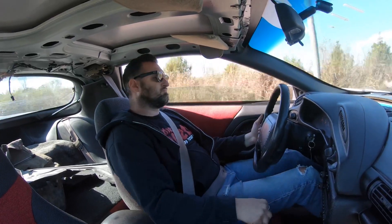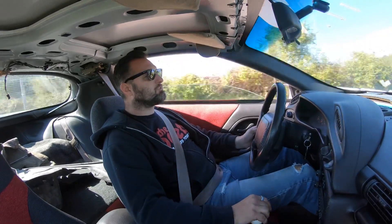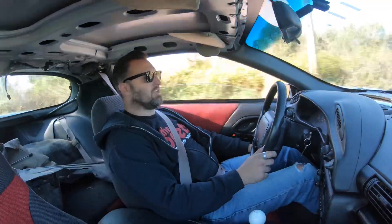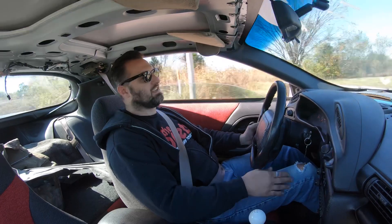We're gonna go for a little ride again. That's looking better already. We'll get it at highway speeds again and see if I can fix that richness issue. Pretty sure I did. More than 60 in sixth — yeah, it's fixed. It was bogged really bad before; it's still a tad rich, about 10%, but it was at like 25% before. That's pretty bad — I didn't know where I was going to be, so it's totally fine. I'm gonna adjust that stuff and continue driving.